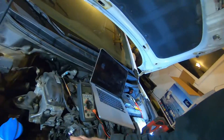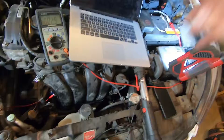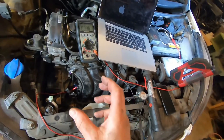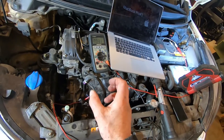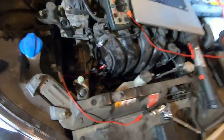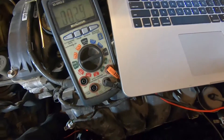Quick update: I still stand by patching rather than replacing the whole wire harness, but I've learned that this wire loom goes down right underneath the intake to a connector joining another part of the harness that goes to the ECM. When I squeezed those two connectors together I heard a click, and now — even moving the wire harness way more than before — I can no longer get that line to go open circuit. So I thought it was a broken wire, but now I think it was probably just a loose or corroded connector.